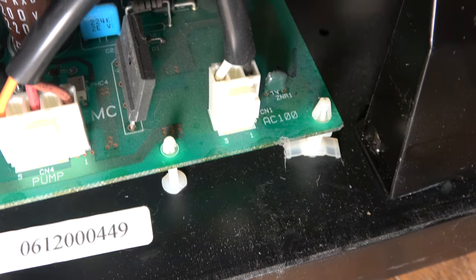Right, let's just take a visual look. There's something interesting going on here. Some sort of factory modification. But basically we have a 7805A regulator there, a transistor, 2SC, I think, I can't read it, 41 something, transistor there, and another regulator there, that one's 7815. Okay, and some chokes and capacitors and rectifiers. And there's our fuse that we've already tested.